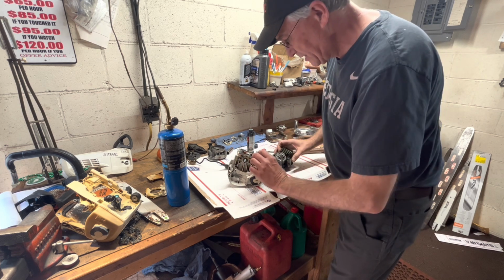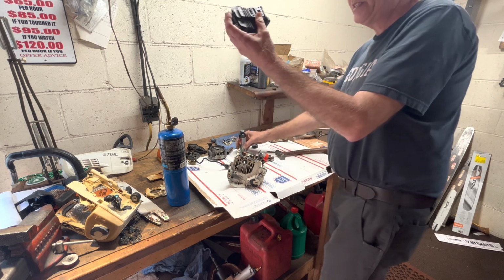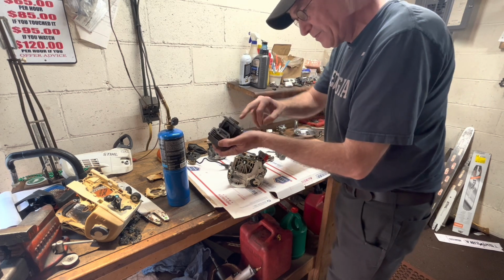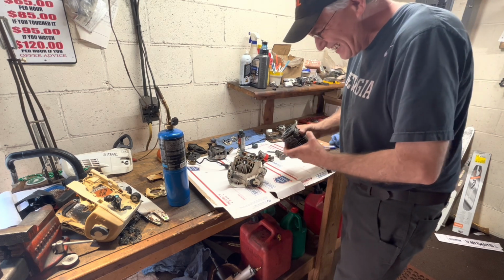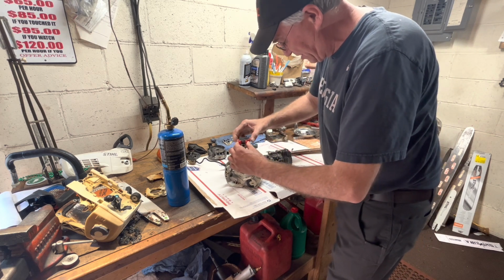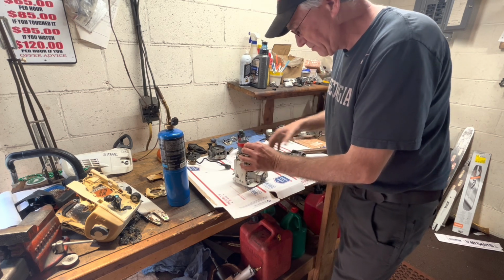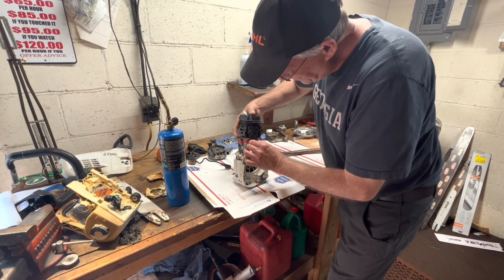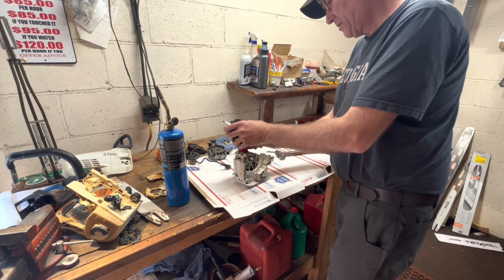Hold on for a sec. Let's throw just a little bit of lube up here in the cylinder. You don't need a ton. Actually, if you put too much, when you go to pull the cord on it, you'll foul out the plug with the extra oil. You just need a thin film just for lubrication. All right, Butterfinger. All right, that's there. Pop that out the bottom.